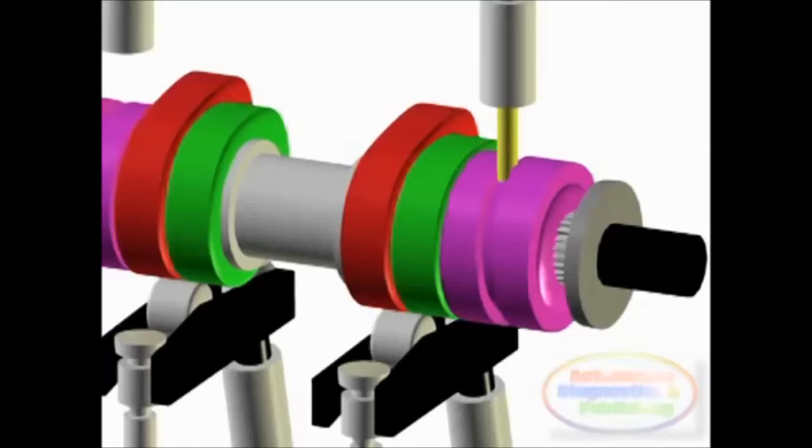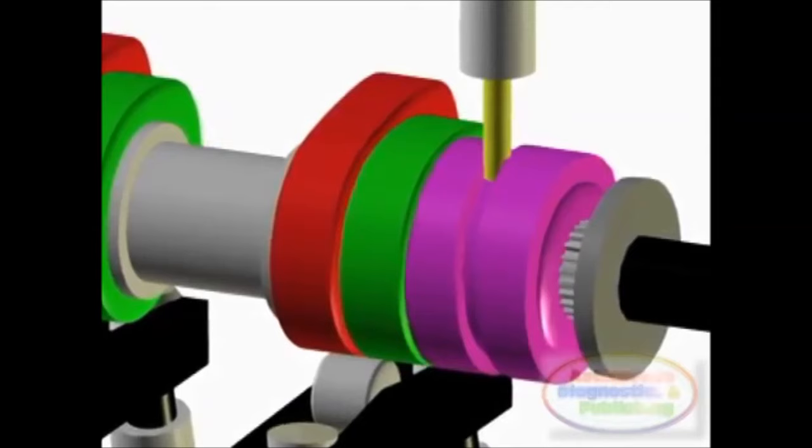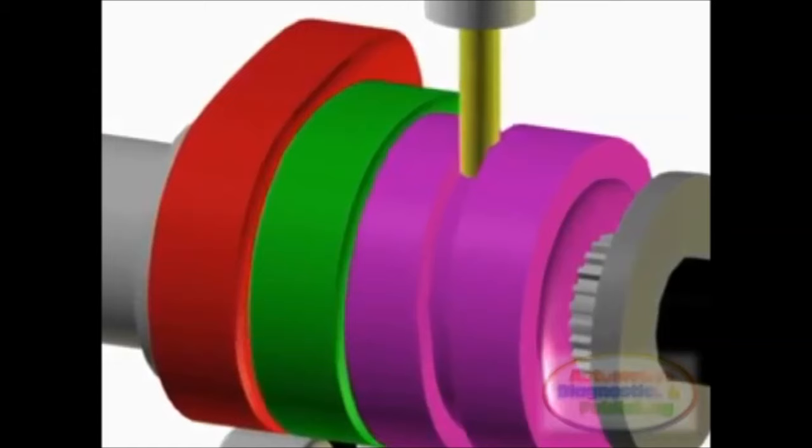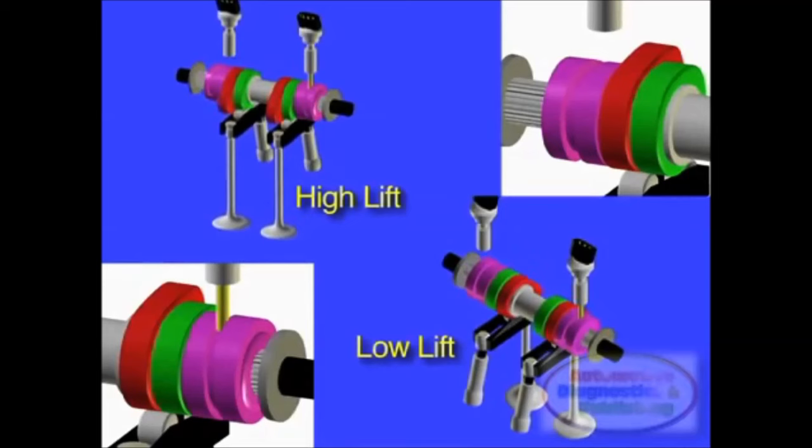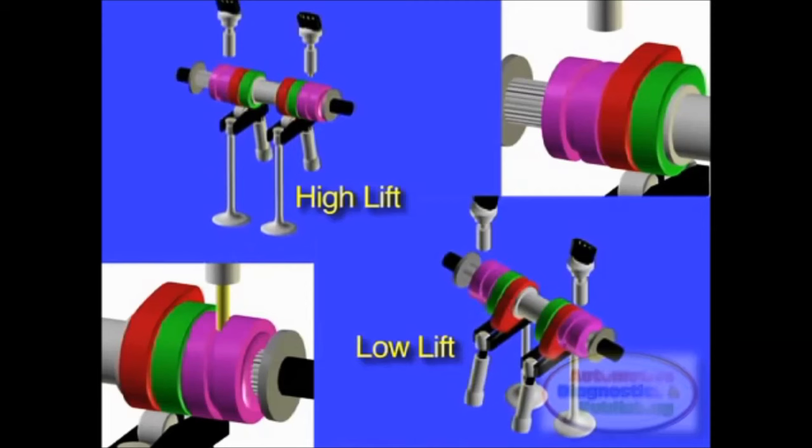The entire actuation process is controlled by a pair of metal pins, incorporated at the valve covers, and powered by lightning-fast electromagnetic actuators. Two of them are responsible for each cam element. There is a spiral groove machined into the camshaft. When the metal pins are lowered, they engage the spiral groove on the camshaft, and push the cam piece by about 3/8 inch in longitudinal direction.